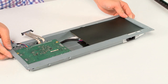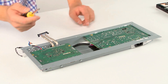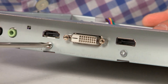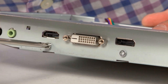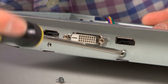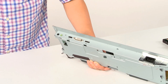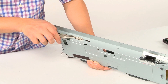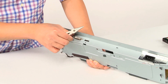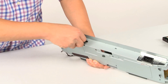You have this component here. Now you want to remove the insulator, pop that off, use a Phillips screwdriver, and unhook these two screws here for the display and HDMI, as well as unscrew the monitor here. Popped one off, popped another. You're going to need pliers probably just to get it unhooked and then just use your fingers.